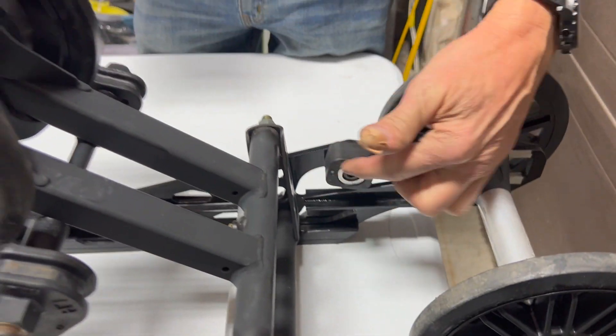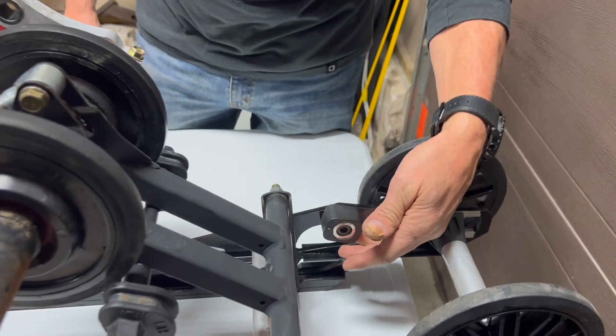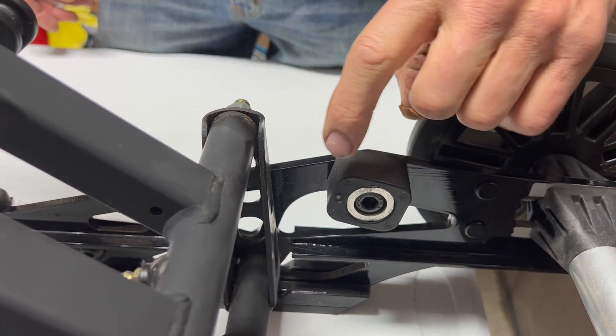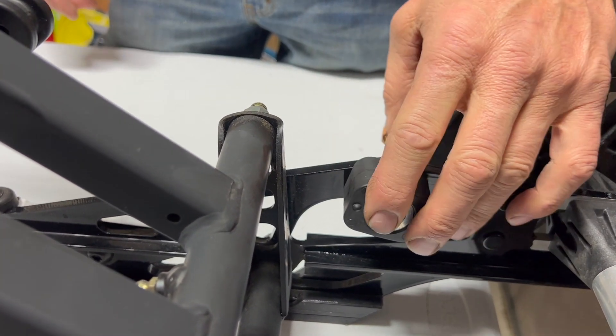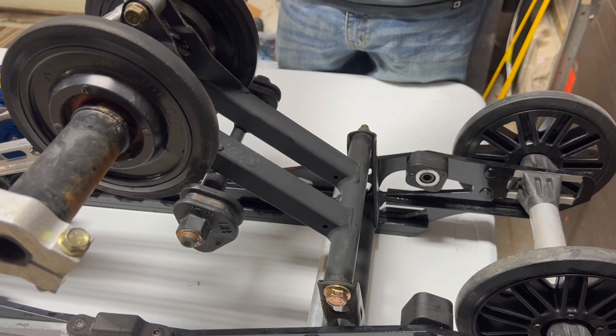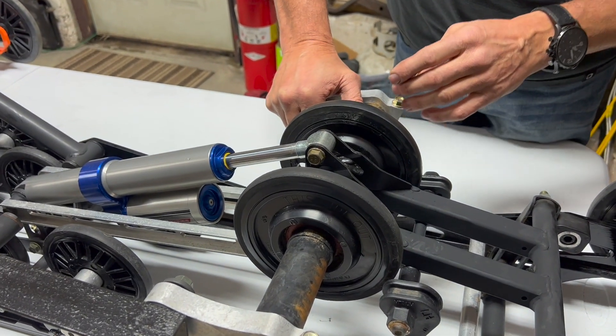The reason they did that - with your turbo, the more power you pull with a turbo it would have the sled riding on the rear idlers all the way across the lake, which you obviously don't want. You want it to be more like a dart, a bullet. In essence, with the old block we were dealing with about 100 thousandths of change between low, medium, and high. It's been 100 thousandths for years, and it does make a change - it affects how much transfer and how stiff that rear is, because it controls how quickly it starts using the spring.